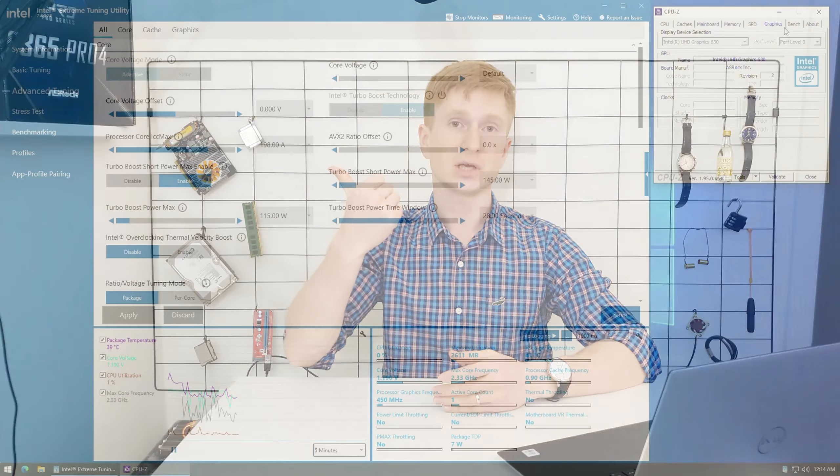After creating a modified BIOS with support for these mutants for your LGA1151 motherboard, you have to flash it onto the motherboard. That's why you need an external flash programmer such as the CH341A. I have a tutorial on how to use that external programmer — I'll add a link to that video.